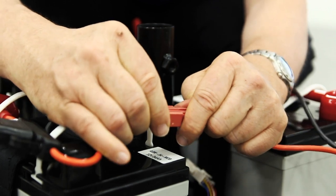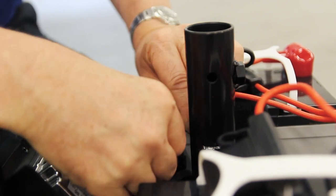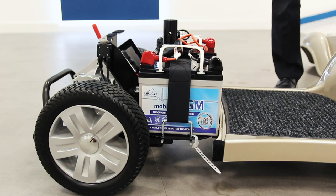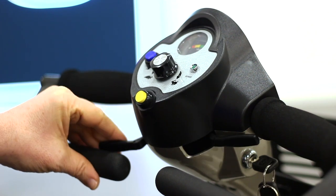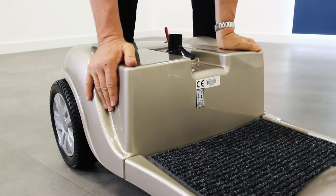Join the two battery halves together, red to red and then black to black. Then the final part is to connect the batteries to the scooter by attaching the remaining black plug, which will make the scooter live. Prior to putting the shroud on, turn the ignition key to see if you have power and pull the wigwag or throttle. A green light will come on if you have power, and you can see how much charge is in the batteries on the battery gauge. Once this is done, drop the shrouding back into place.